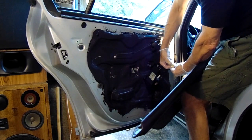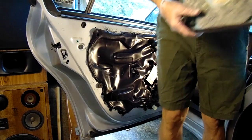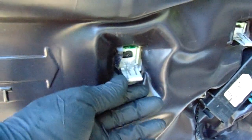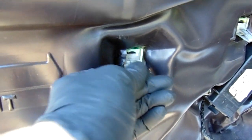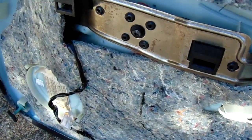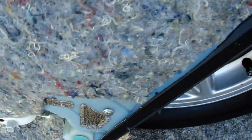You can just push it in with your fingertips, remove that, and set the panel aside. Now let's go over the two clips that are much harder to remove. Right there are the two clips — they're supposed to slide straight up, but as you can see they're being very stubborn. You really have to take the whole door panel and jiggle it side to side, back and forth, slowly moving these two clips up until they break free. Once you get the green tabs loose around the perimeter, you have to deal with those two clips, and it's quite hard.